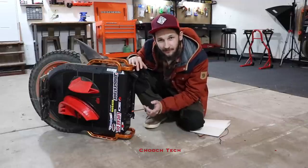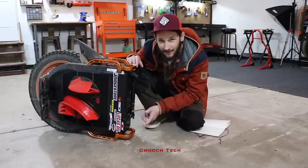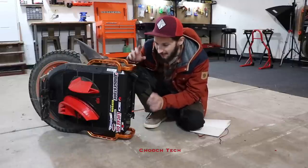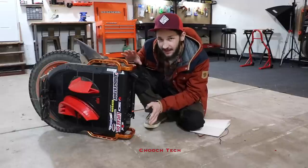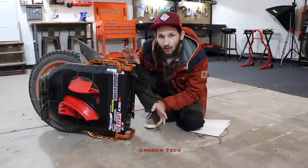And then finally I was like, all right, there has to be something up. And I looked in the settings and the braking was turned to zero. And I turned the braking up to 100%. Acceleration up to 100% and braking to 100%. And that's where I've been riding it since the second day I've had it. And it has been great, guys. It made all the difference in the world.